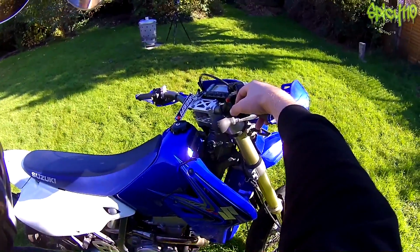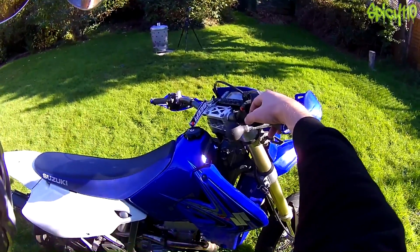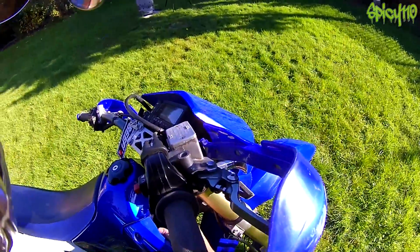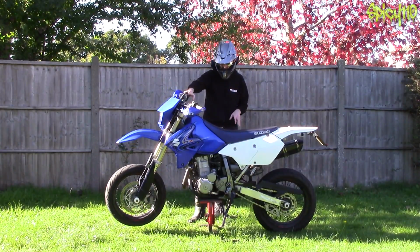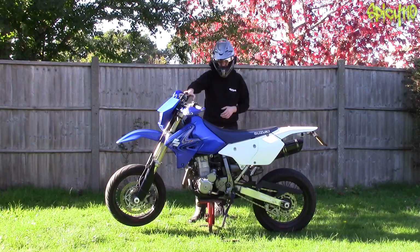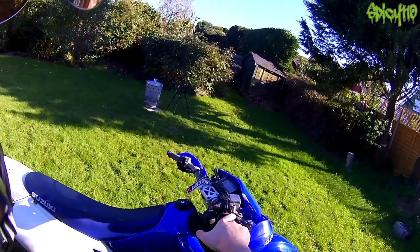The other thing at this point is the radiator. Make sure that you have enough fluid in there, make sure that it has enough antifreeze in it. There's normally a filler point up here somewhere. You should also change that periodically, flush the whole system out and put new stuff in. But that is something you do maybe yearly, every couple of years, depending on how hard, again, the bike is run, and obviously the condition of the coolant and the amount that's in there.